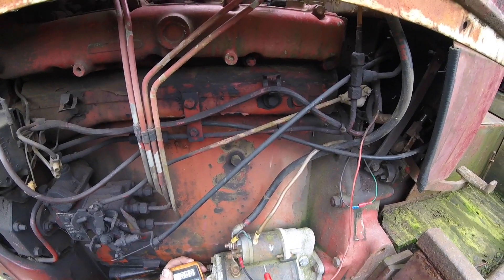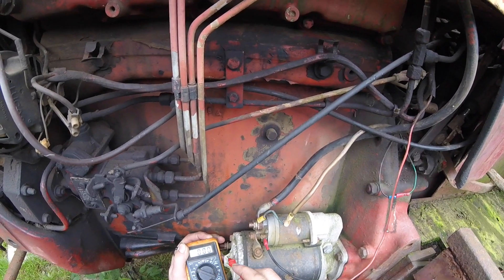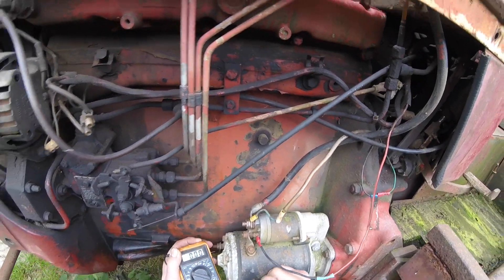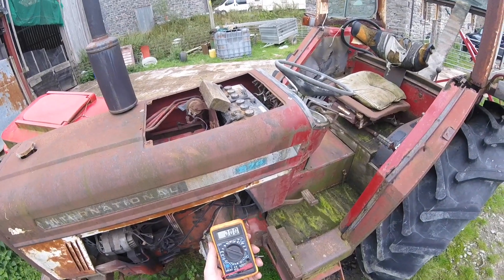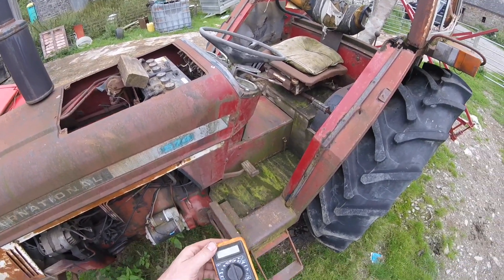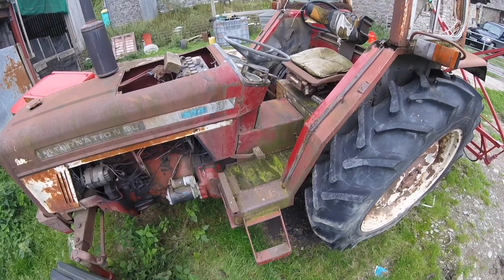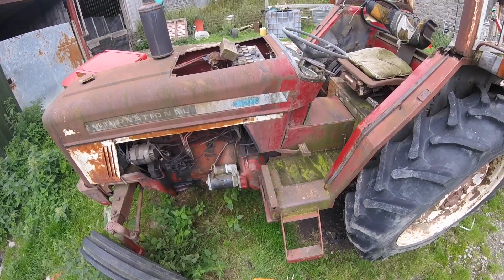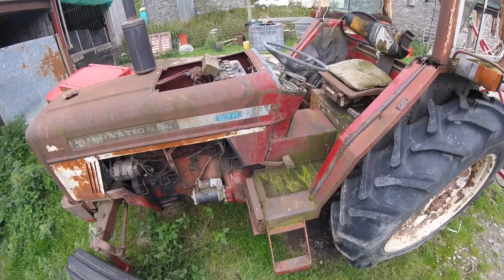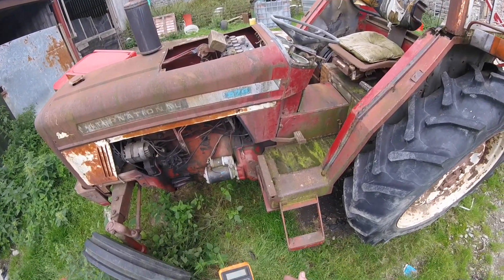So if you were putting in the back of your radio, for example, you'd do the thing I said before by trying to find the earths first. And then to find the positives, you get the black probe on the earth and just go touching the wires. When you get a reading, they're positive. I hope this has helped you out. I'm sorry the meter is playing up — these old things don't last very long. You can pay a bit of money and get a decent meter, but that's up to you. So I hope this has helped you out. I know this is an old tractor, but it was a simple thing to show you how to find basic positive and negative terminals and wires when you're not quite sure, because when you're doing it in a car, in a radio, or in a tractor, trying to find if they're positive or negative, it's very easy.